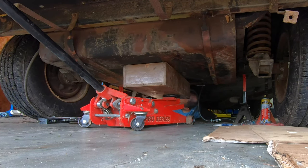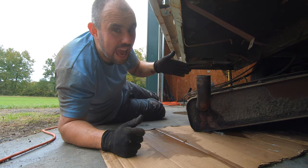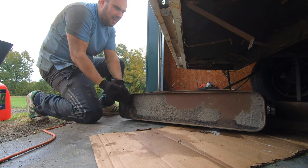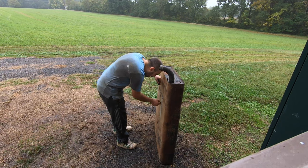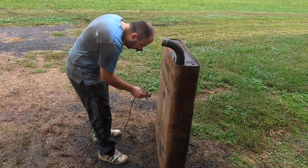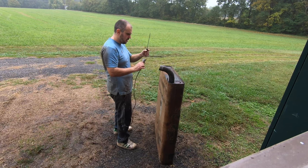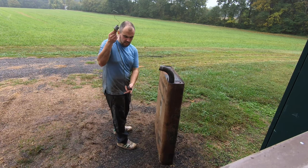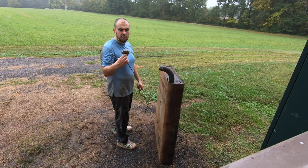Okay, that's one loose. And that's the second one. This thing is heavy, especially because it's full of petrol. I've just taken the screws out for the fuel level sender and I'm hoping... Ooh. Comes out in one piece. The reason why the fuel level sender might not have been working, if the wiring wasn't broke, is that the floats fell off the end.